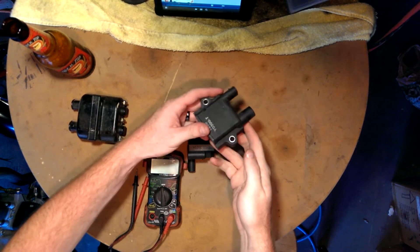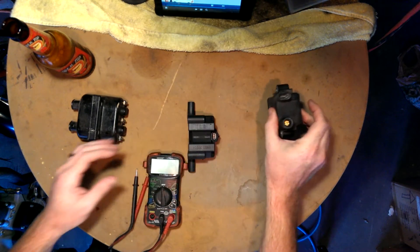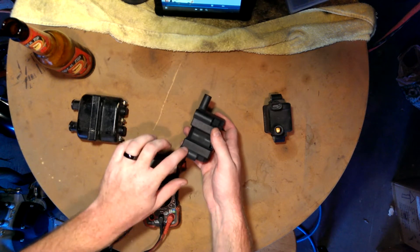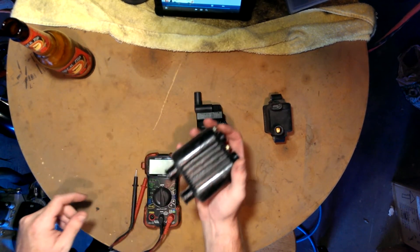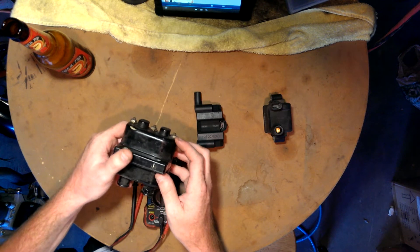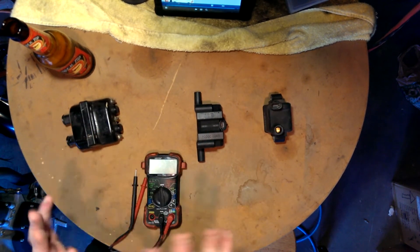We have a coil from a Blast — it's the ignition coil. Ignition coil from a Blast, ignition coil from an XB — XB9R, XB9S, XB12R, whatever is from an XB. Part number Y0300-0288. I think this one is from Crane — it was given to me. I know it's 3 ohms, that's what matters. This is a 3 ohm coil. Half ohm, half ohm, 3 ohm — I'll show you what those mean in just a second.